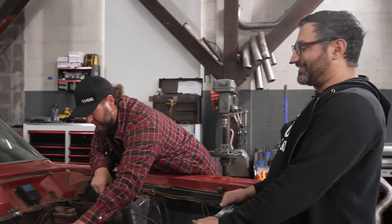I'm trying to figure out a little trans cross member scenario preemptively. It looks like there are numerous slotted holes in the subframe, we'll call it, for probably automatic or manual transmissions. But we got this cross member, I think from S&W maybe. So I'm just going to put a couple of little brackets on it, and then we can slide it and drill the holes later once the engine and trans are in the car. But figured get some moves being made here. Yeah, right about there, right in the heart of it. About 6 inches or so past. It's pretty close, man. Really? I thought it was so much farther back. I grabbed that piece of tube and I'm holding it out here, that's why I just measured. This is the original trans cross member. Well, for making this custom, let's just put it in crooked and it'll fit right through the hole. Exactly.